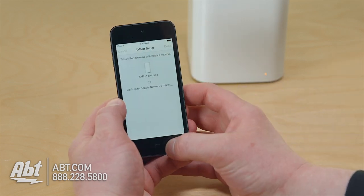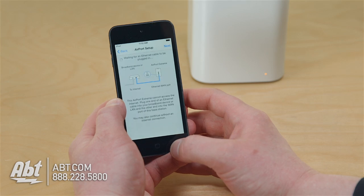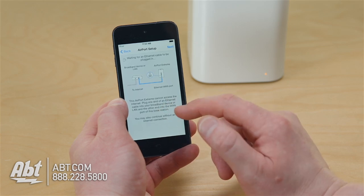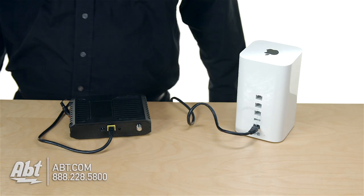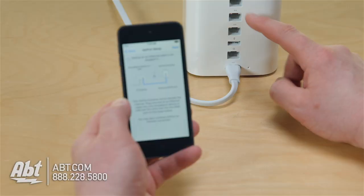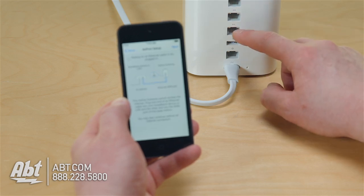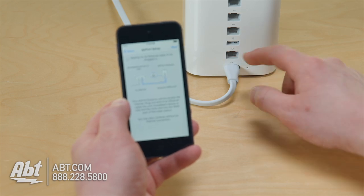Let's save my password on my iOS device. Now it's going to look for the network temporarily broadcasted from my router and connect to it. One thing to note: in your home, you have the modem from your provider and you're going to run a CAT5 cable to the back of your Airport Extreme Base Station. On the back, you've got three Ethernet ports on top — we don't want those. We want the bottom one, which has a circle above it. The top three have arrows pointing left and right and are for other equipment like a computer or networked devices. The bottom one is for the modem, so plug your modem into that one.